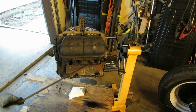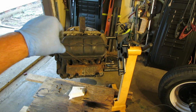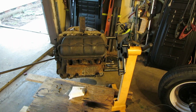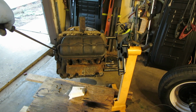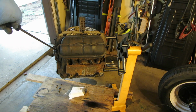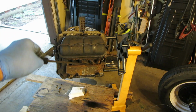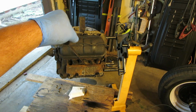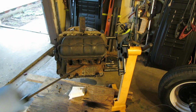But I think the parameters in this are going to be so much better, even if I have to repair it. So that's why I want to try to make this work. We'll take this apart, and what we'll do is we'll clean the block up a little bit. We'll put the bearings on the crank, and we'll put the crank in it, and see if the new bearings walk in that. We'll examine the old bearings also to see if they're Captain Obvious why they're walking, and if they don't walk after I do that, I'll repair the studs and we'll just go on. Remember, this is only making 53 horsepower, so you know it's not going to be a 200 horsepower engine. So I think I can get away with things that I don't want to say are marginal. Okay.